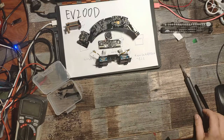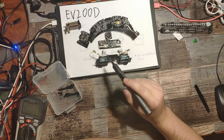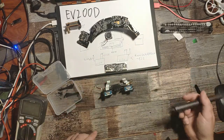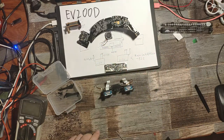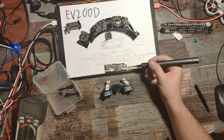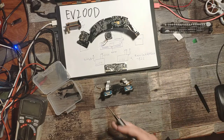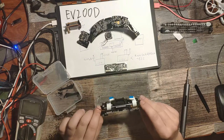So I tried to find out where the problem could be. At first I tried connecting this LCD to the outputs of the other side of the LCD driver board, because the LCD driver board gets its signal from the main board, and the main board gets it from the Rapid Fire. The connectors on both sides are identical. I tried it on the right side path and the module worked — so the module wasn't the problem.